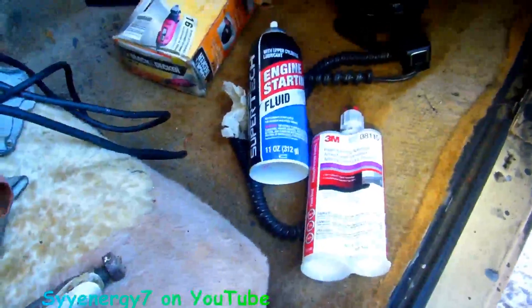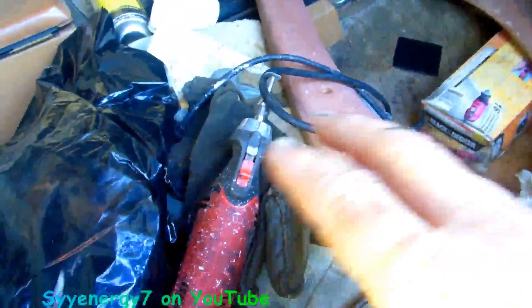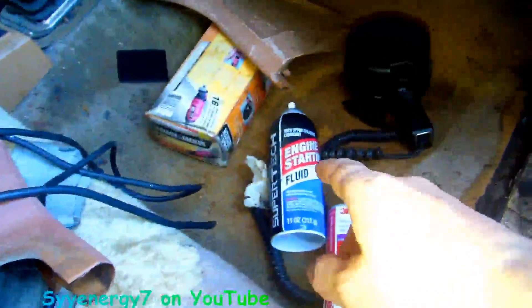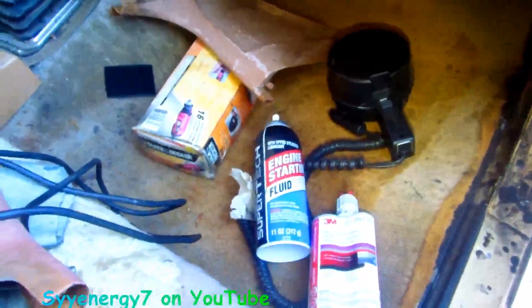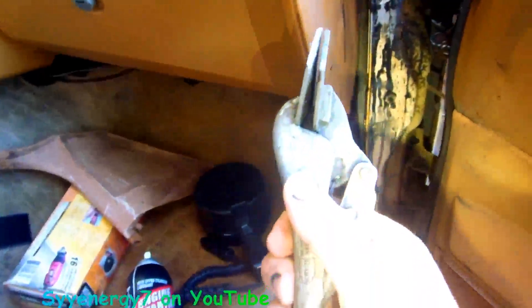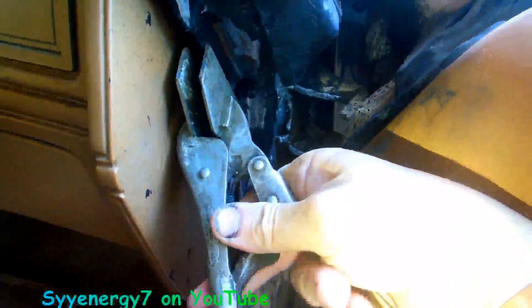It takes a long time to dry, but what I did was I cleaned it off first with the Dremel tool, made sure the metal is scratched up really good. Then I cleaned it off with starting fluid ether — or you can use brake cleaner — make sure it's really chemically clean. Then I clamped the metal down with a couple of clamps, had it clamped in there and let it sit for about 12 hours. And it's solid.